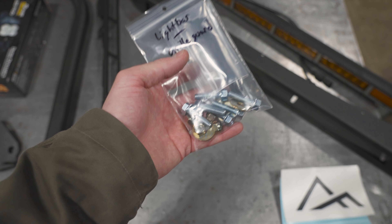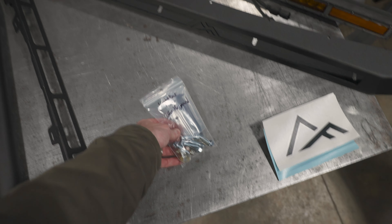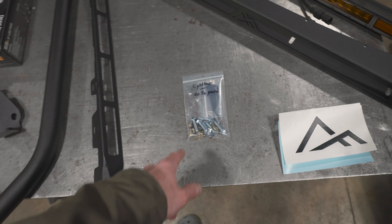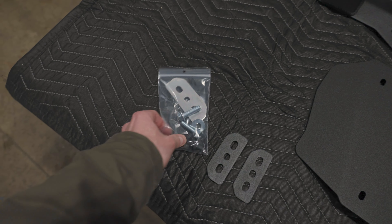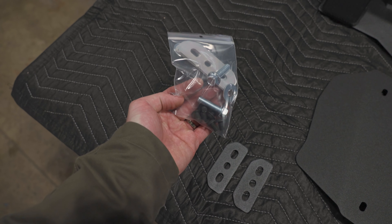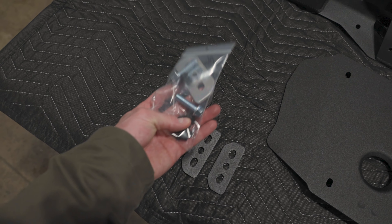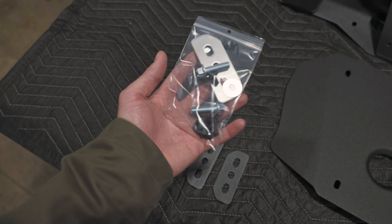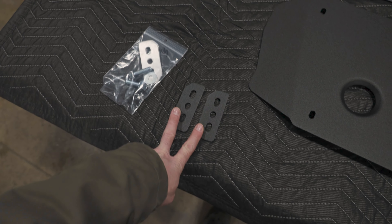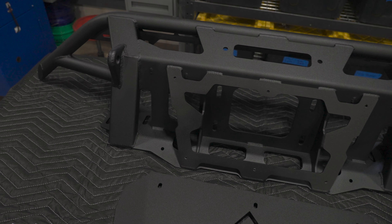At the end of the day, you could also just cut your cover really nicely and run the bumper alone with no lights, bull bar, or light bar. This hardware is a mixture of grade 8 and class 10 — really durable — and that's everything you'll need to attach the light bar or the grille guard. He actually imports this black hardware for the front aluminum plate from Europe because it's really hard to source black stainless hardware in the US, and most people just anodize silver hardware that eventually fades or turns purple. These same plates have been powder-coated since my rig is blacked out.